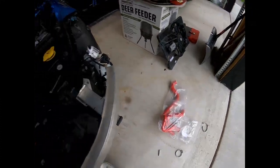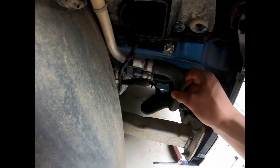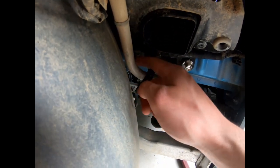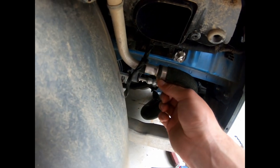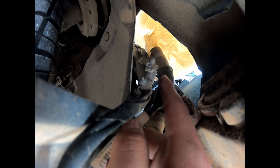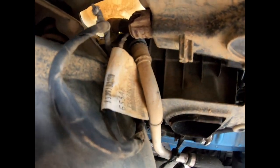Right now I'm going to work on the rest of the cooling system and get this swapped over. Starting with removing the old radiator hoses — we have this hose over here on the passenger side that comes right underneath the headlight and also the intake. This is where it connects to this metal pipe piece. This clamp is a one-time use on this car, so it's going to have to come off. There's also another one that goes up to that coolant tank right on top of the car — that little black piece also has to come off as part of the hose kit.